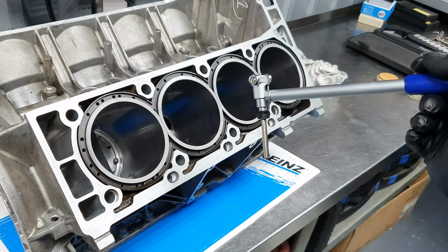And once again, to the guys outside, this doesn't mean that it's new. It's just been cleaned. When somebody washes his car, he's not making a new car. It's just been washed to see what you have to deal with. It's different to be on specs and okay, and different to be just cleaned. The pistons that you see that have carbon on the top, this doesn't mean that it's a new piston. This is a used piston with a run out. You see on the skirt it's been polished at one spot here.